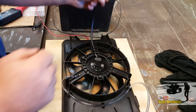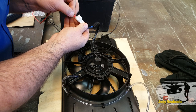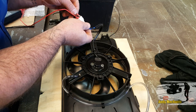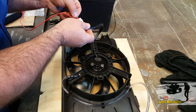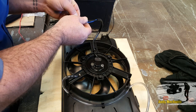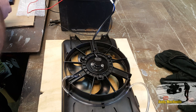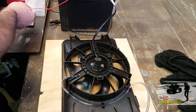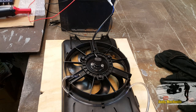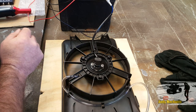We've got the plug on the fan — the blue wire is the positive feed, so we can plug that into there. And the black is obviously a ground, so we plug that in there. It's important to get a good connection. We've got our amp clamp on in the correct direction, onto the positive feed wire. And we can turn on the fan — to turn on the fan, all we do is connect the ground wire. There we go — the fan's now working.